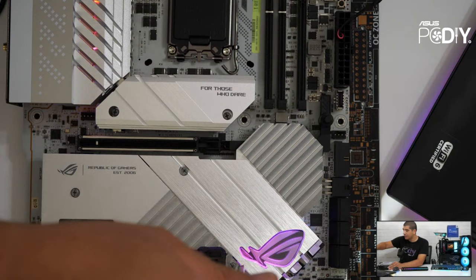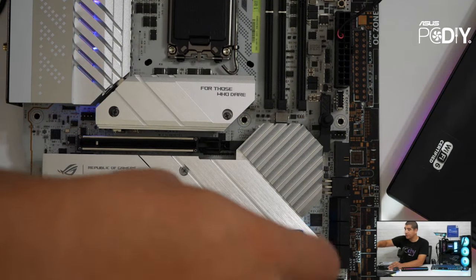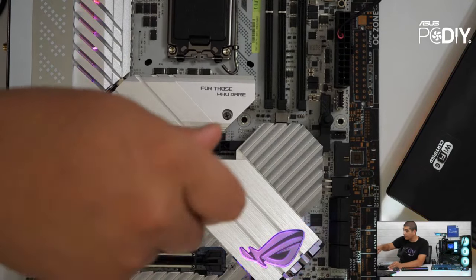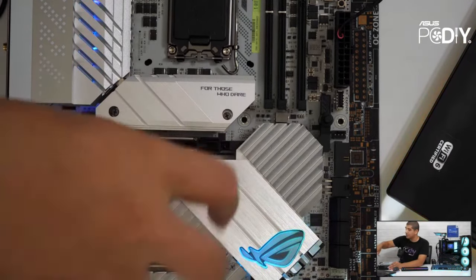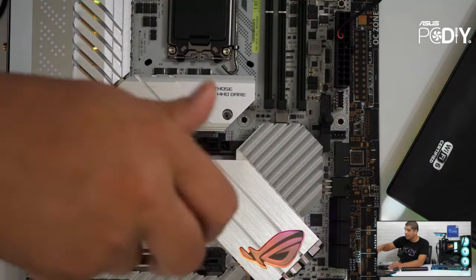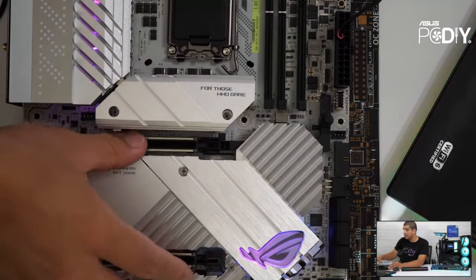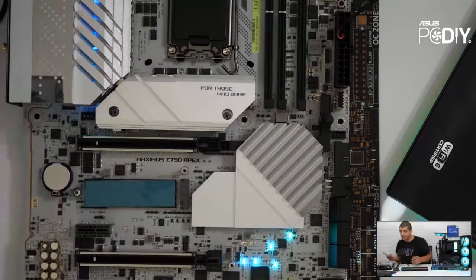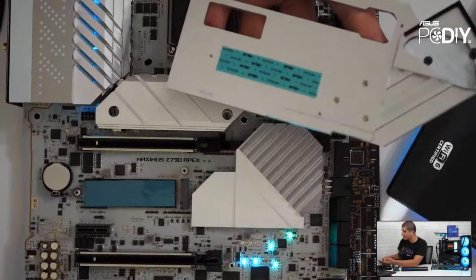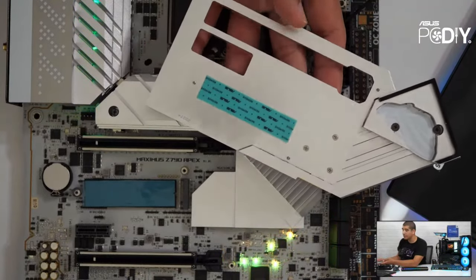I would love to see 90 degree 24 pins. So I can tell you the reason why we don't do it is because it doesn't make sense. The reality is that when you start to add a 24 pin to a lot of motherboards, especially the ATX based motherboards, you run into a much higher level of mechanical conflict issues. Some users say that they like it, but when it's actually tested in a broader segment of chassis, it presents more issues. We can go back more than a decade and we've had motherboards that we've done right angle based connectors, but they just don't tend to be more mechanically suited to reducing issues when it comes to interoperability and compatibility when you install them in different types of chassis. So that's the reason why we tend to not favor right angle connectors on our designs.